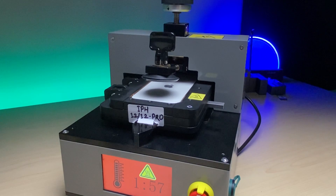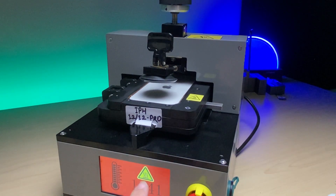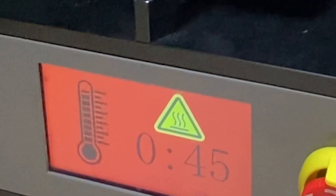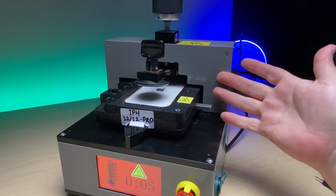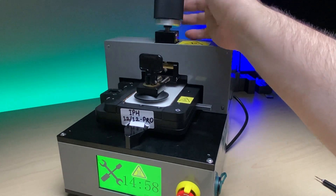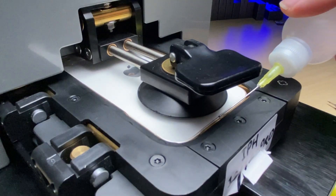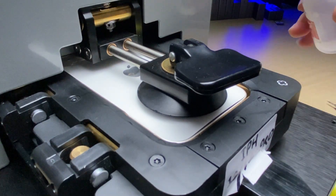It's now switched over to a two-minute countdown. To assist in this, I'm going to be using some 99.9% isopropyl alcohol. As soon as this counter reaches zero, it'll switch over to the 15-minute countdown, which will allow us to start the back glass removal. I like to be ready for this timer because it is really annoying the way that it beeps. I'll lower it all the way, engage the suction, and slowly twist it the other way and lift it up. Add some isopropyl alcohol to give it some assistance and let it let go nice and slowly — and there it starts to go.